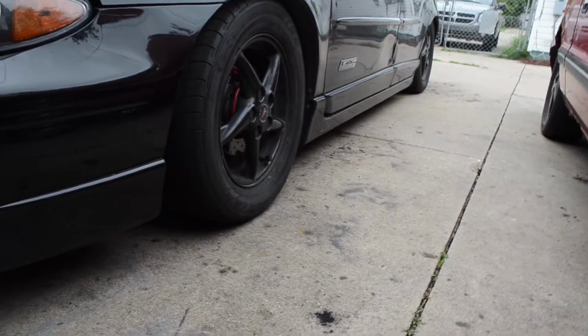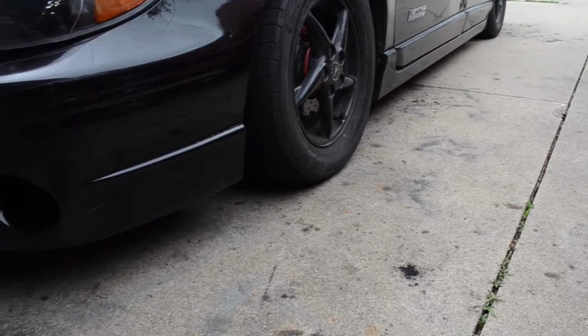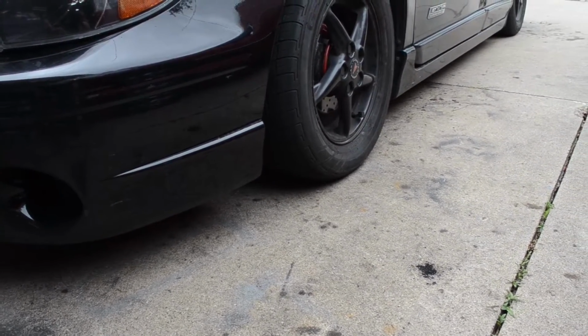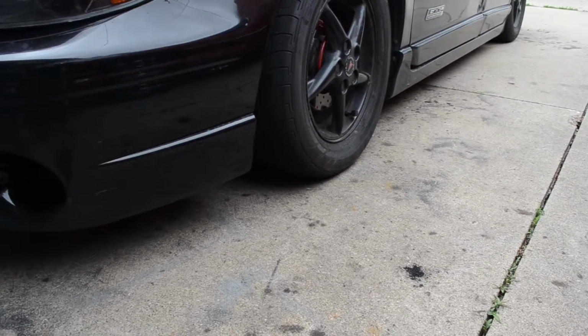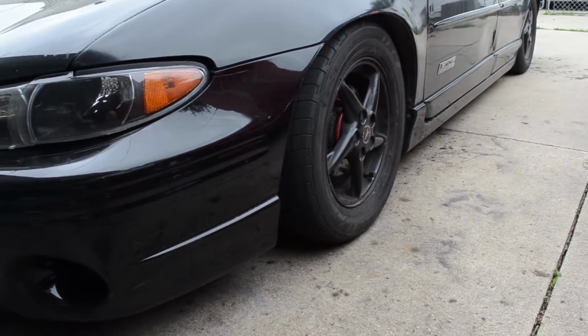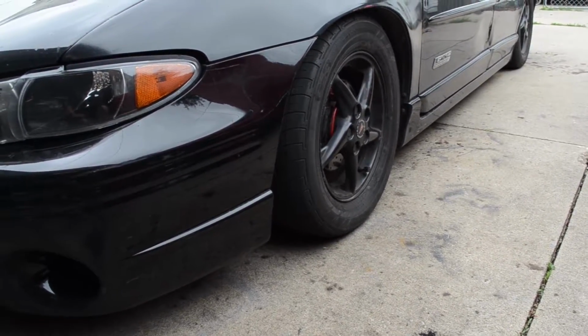They're on. No modifications. The only modification I did do is the front ones. I put thrust bearings for steering in it. But that's it. That was $60 at Summit. So $280 total. Which if you have normal coilovers, odds are you're gonna have to replace those thrust bearings at some point anyway. So unless you really take care of them, keep them clean, they're gonna get some crap in them and destroy themselves.